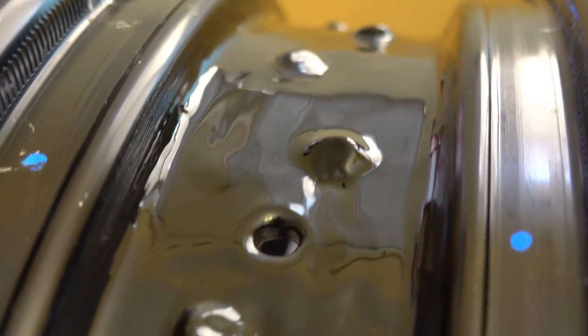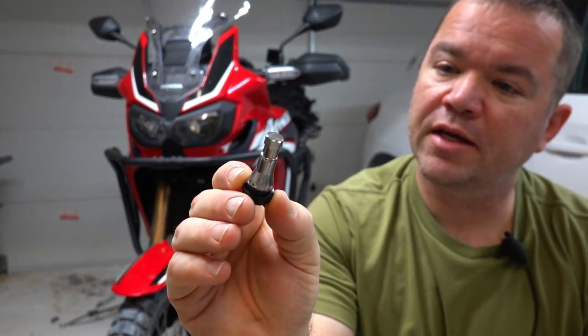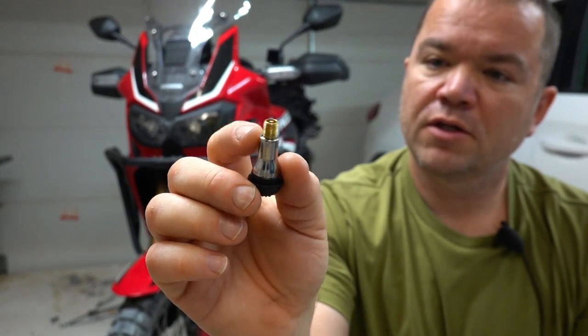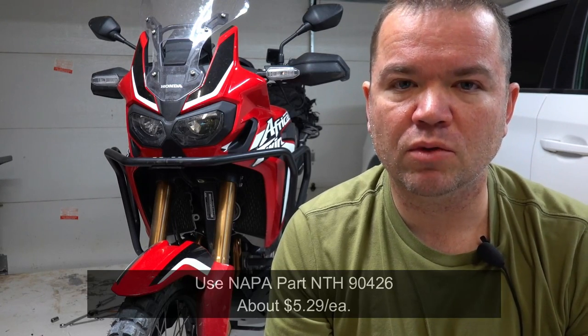I double checked, waited a few moments, and inspected both sides of the tire — it was great. One quick extra note: make sure you get the right valve stem for your tire. I was at the auto parts store and saw some valves that looked like they'd fit, but they were nowhere near long enough to go through the rim and give you room to put a cap on or air it up. I tried about two or three different types and none of them worked. I found an awesome video I'll link below with another guy who did his tubeless conversion, and I'll duplicate the part number. Napa Auto Store sells them — just make sure the one you get specifically says for motorcycle rims.